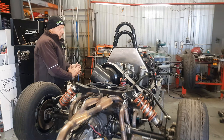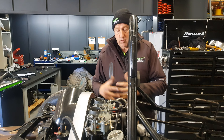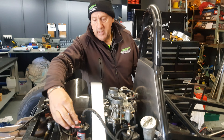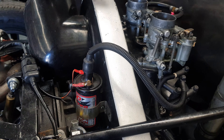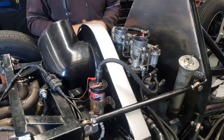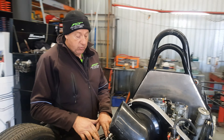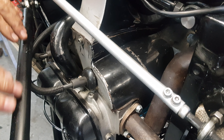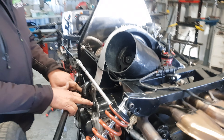Coming a little bit further forward, obviously we have an engine — a power unit — which hopefully is all good from last year, and we've got a new one which will be even better. Just make sure that your coil's tight, your leads are tight, wiring's out of the way, it's not going to get entangled with the exhaust, the fan, anything like that. Make sure it's nice and neat and tidy and everything's functioning well. Spark plugs — common thing — make sure they're in properly, and it's not a bad idea to check the tightness of your spark plugs once in a while because the last thing you want is spark plugs falling out, which does happen now and again.